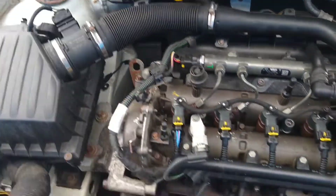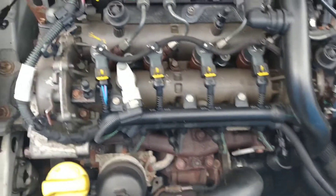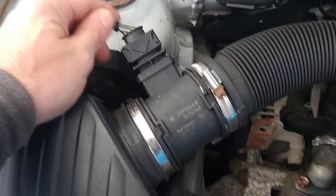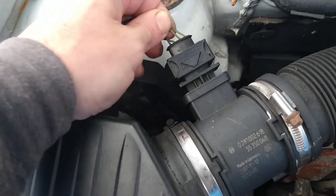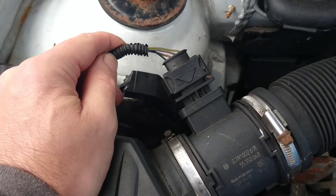I was only really concerned looking at the fuel. I think somebody's done a leak-off test on this and changed the pump, and they still had trouble with the fuel, so I just thought I'd do the fuel checks and get them out of the way. But everyone's right to notice this — that is too much grams per second, because it's not even cranking. Or if it is cranking, it's still way too high. It would be too high for idle.